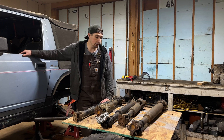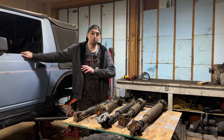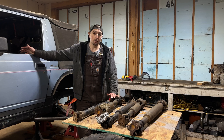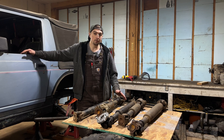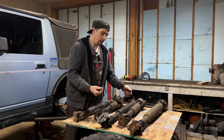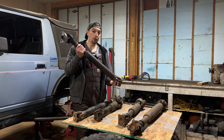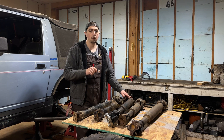The front is basically limited by my caster. Since my pinion is at four and a half degrees, it's nowhere near pointing directly at my T-case, which means a double cardan shaft is probably not ideal. On top of that, double cardan shafts have very limited driveline deflection and don't have a very high operating angle. The first gen single U-joint can run at almost 40 degrees of driveline angle. My main factor is that I need a really high operating angle, and single U-joints are the best choice for that without finding a unique double cardan or grinding away part of the internals — which compromises structural integrity.